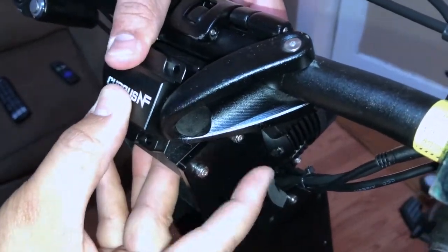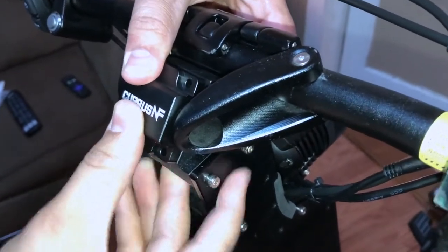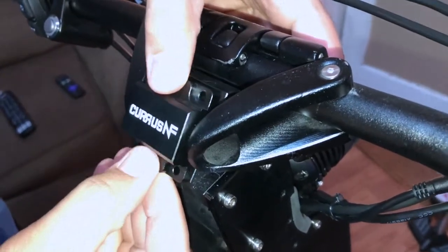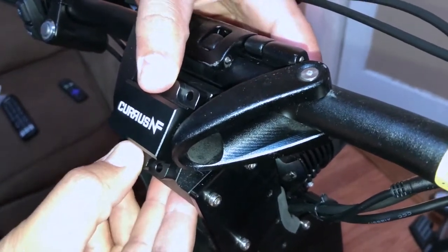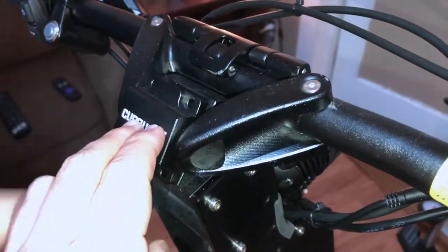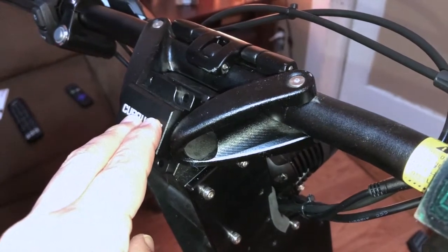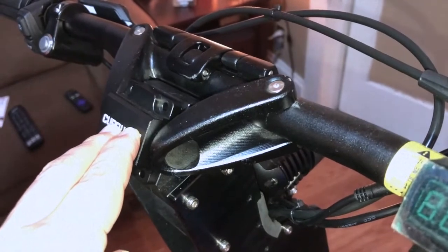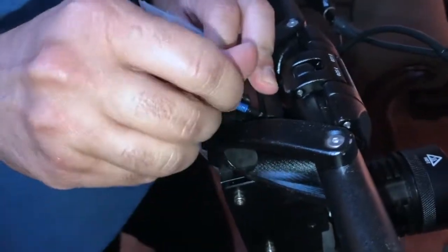When adjusting the handlebars with the face plate to secure them, I like putting it about one notch up so the handlebars are not rubbing against any other metal on the handlebar assembly. Be very careful with the alignment of the face plates. I used my wife's hand — she was holding the camera — to hold it in place while I used my other two hands to grab the bolts and secure the face plates.